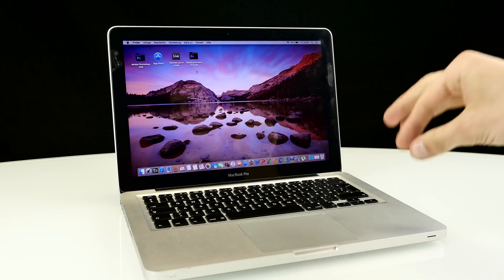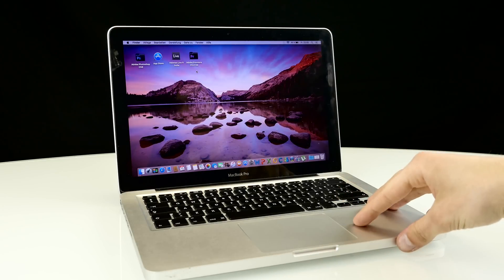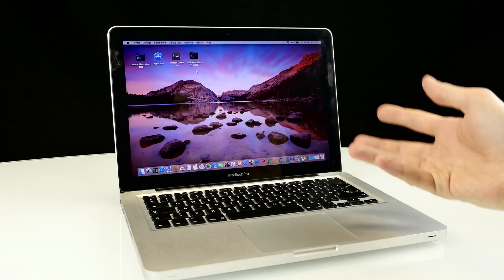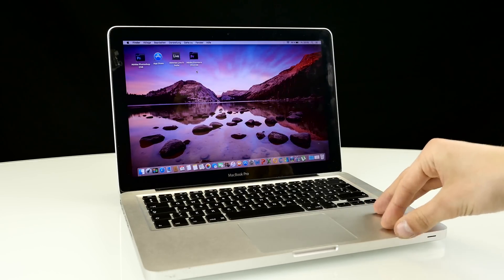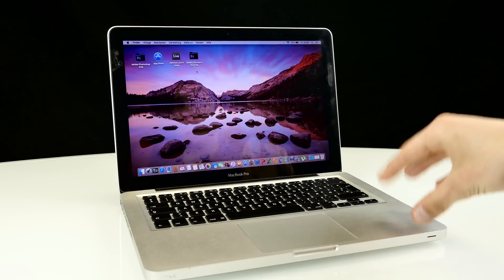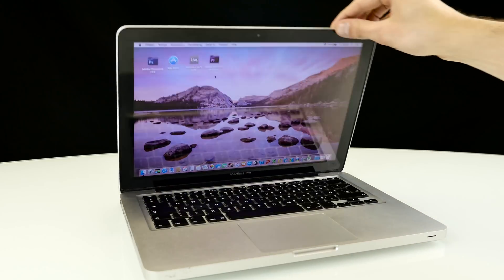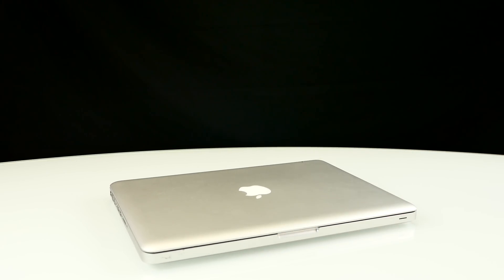One thing to note: be careful with the OS X reinstallation. It was very picky — it only installed successfully with the original four gigabytes of the eight gigabytes installed; the installation failed every single time otherwise. MacBooks can be problematic in that way when upgrading and reinstalling. But it's definitely worth it to give your old MacBook a little extra speed if you don't want to sell it. Thanks for watching — I hope this was helpful, and stay tuned for a review of the new MacBook.